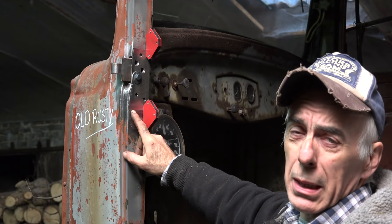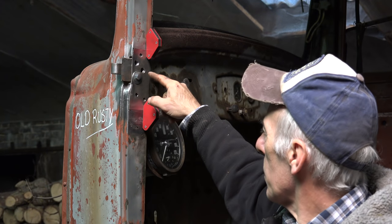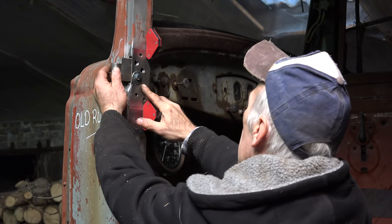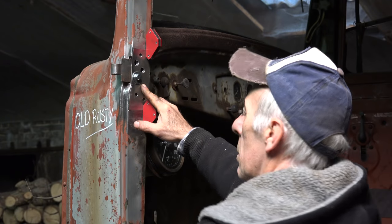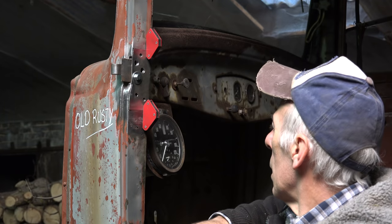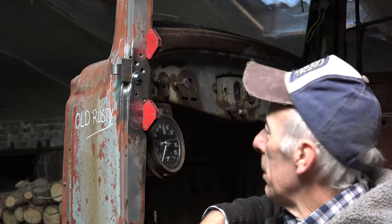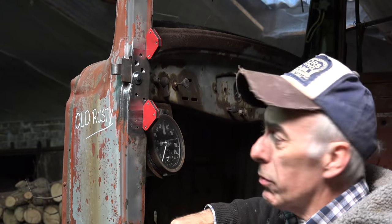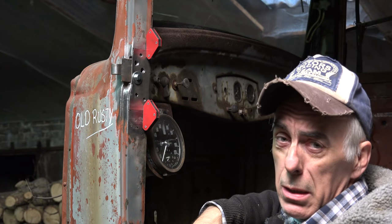I've built a little metal plate - it's just a flat piece of metal and I drilled the holes in it for the screws, but I made them a little bit bigger. That allows me to move the hinge back and forth, and I have play up and down and left and right, so I can adjust the door gaps a lot better than before. I'm going to start welding this in place now. Those red things are magnets - very handy to keep sheet metal in place for welding. Let's start welding.